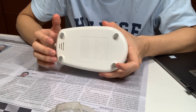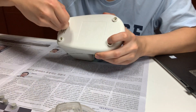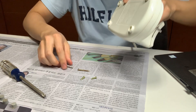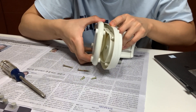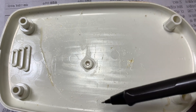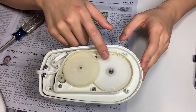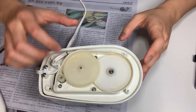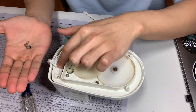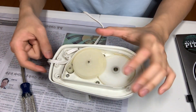Now to the bottom. First we'll need to remove these rubber elements because there are screws hidden under them. Here comes the bottom plate. This is the inside of the bottom plate, and as you can see, there are circular sections all over the place — I think these are also evidence for injection molding. Now this is what you see when you remove the bottom plate: there's a gear train here, with a smaller gear under the middle gear, and these gears all mesh pretty nicely. I also removed two screws to investigate a plastic piece — likely injection molded — that holds the cable in place.